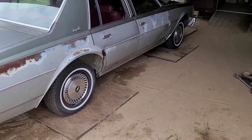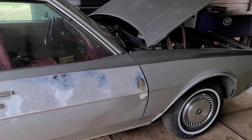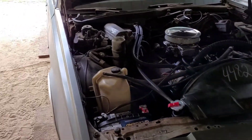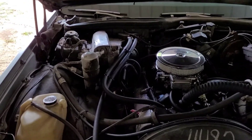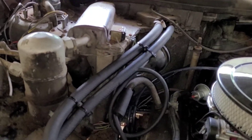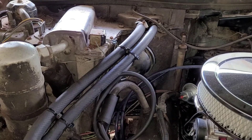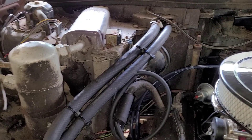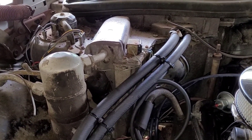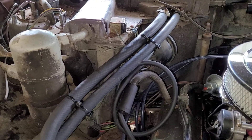I'm coming back to you again today because it's time to try to address the brakes on this car. I also found out about an issue my best friend told me about — I got coolant leaking from what I think is the heater core, and I figured I probably have to replace it. Whatever you guys do, if you got a car like this, one of these B-body sedans, you do not get to the heater core from under here — you will destroy your HVAC housing. Trust me, I did this 15 years ago in the first '79 that I had. But I'm going to address that later. Now that I know where it's coming from, I'll do what I got to do to fix it.